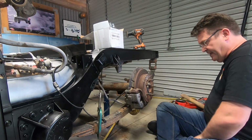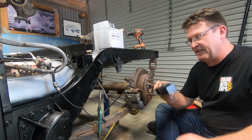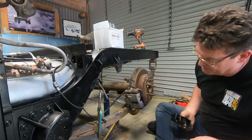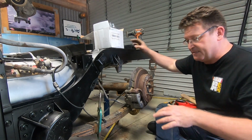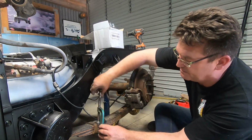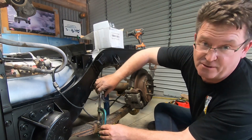This can be moved away. And we're going to take that 2 inches and we're actually going to put it on top of the springs underneath the diff and lower the whole car 1.5 inches using these blocks. Now all I have to do is undo the diff. The diff will sit there fine. That's all good to go. And I can then give it a broom off, and then I can give it a quick paint, and then I can fit it all back together again.